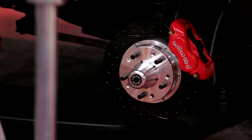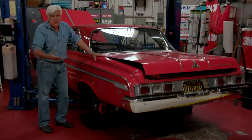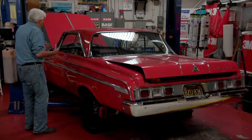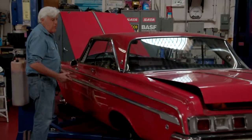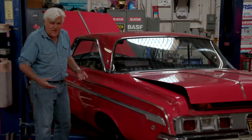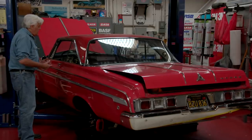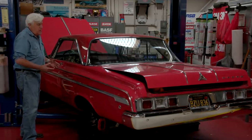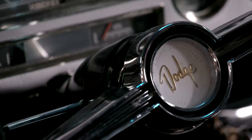I took off the mag wheels and it was all jacked up. We put Wilwood disc brakes — they make brakes for almost any American car. When you have something like this with close to 400 horsepower, it's really fast. The Max Wedge brake drums were an inch wider because they knew it was powerful, so you could get metallic lining and it stopped pretty good — but not as good as a brand new set of disc brakes. The interior I believe is all original, as is the chrome — nothing's been re-chromed. No power steering, no power brakes — what they used to call a man's car. Everybody credits the GTO as the first muscle car, but with the 426 and four-speed, these were really powerful cars, and Chrysler was at the top of their game in the early-to-mid '60s.